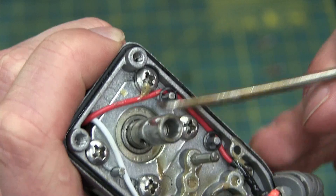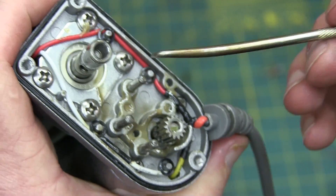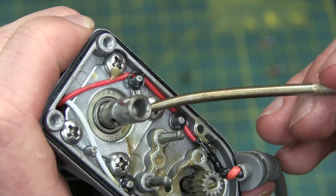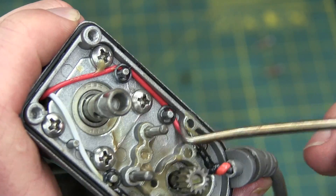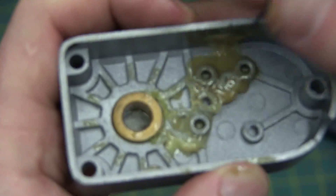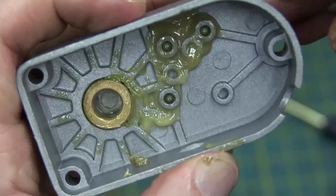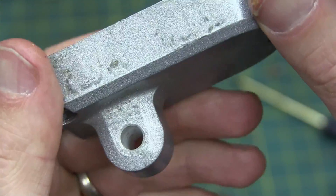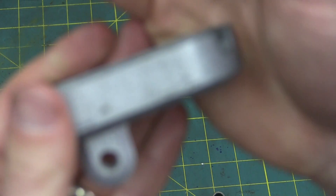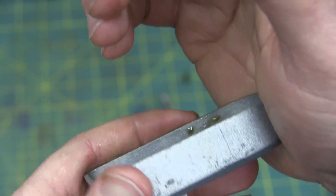There's a novel idea for the wire retention. Of course two wires go to the limit switch, and there are two limit switches — one for reverse and one for forward. We've just got these little spring pin retainer clips to keep the wire from getting in the works. And in the rear basal platen we have a little thrust washer and an oil-impregnated sintered bronze bushing. And the housing — nicely painted. Of course the metallic fleck paint — that's not metal at all that makes the fleck; it's actually the mineral mica, a flat platelet type mineral, and it is in everything.